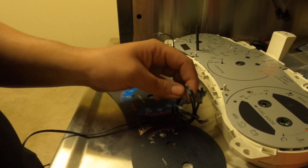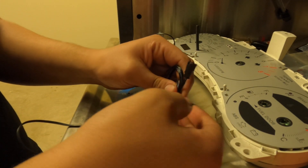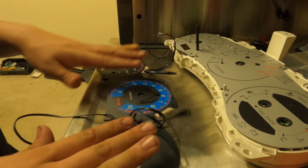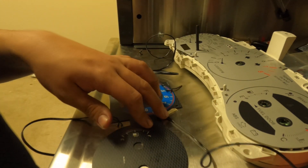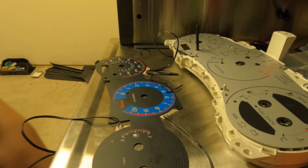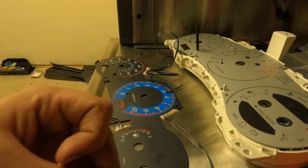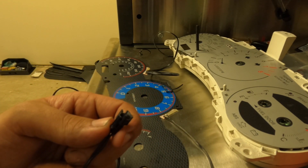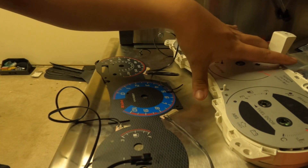Now as far as this, I've already taken the liberty on some of these to pull these off. There are just a couple of twist ties here. You're going to undo those twist ties. You want to be very careful not to bend this because they are extremely delicate since they're technically plasma dials. Just pull these out, stretch them out, get them flat. The wiring for this is actually incredibly simple — there are plugs on each one of these, all three, that run to a single jumper pack. It has what they call an inverter that's going to take your 12 volt and actually power each one of these.